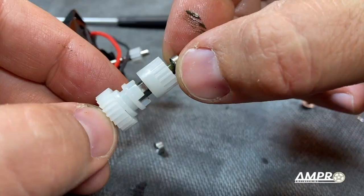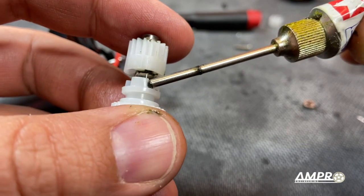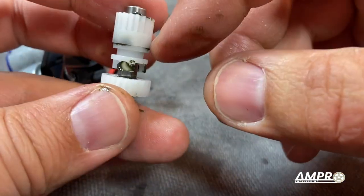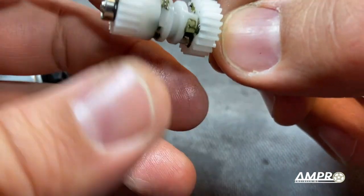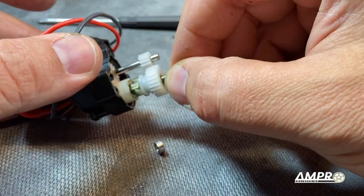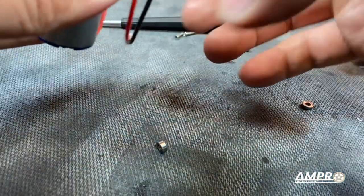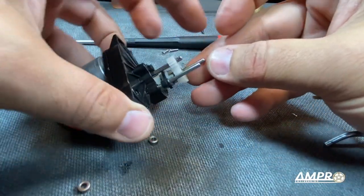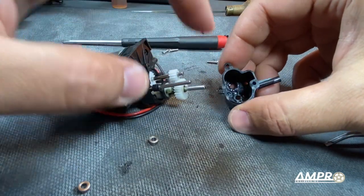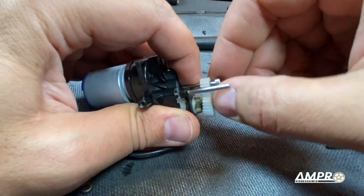Put a bearing on here. Bearing — get on there. We'll put a little bit of grease inside here as well. It's really not all that important because it doesn't move much — it's basically for when it goes in. You don't want to put too much in there because it can actually hydrolock, which means there's almost a suction action so that when the servo is trying to move it from left to right, it'll be a lot harder and either be sluggish or potentially get stuck, because it's probably not the greatest servo in the world. Let's put that in here — everything seems to engage nicely. This is our shift fork; this came pressed on, so that'll go there. So I'm going to put a bearing on this shaft here as well — this bushing was also having issues.